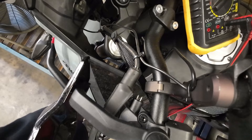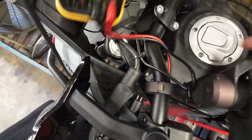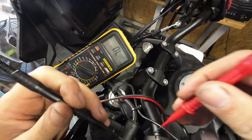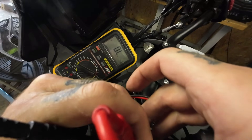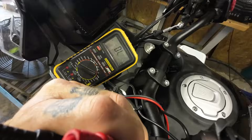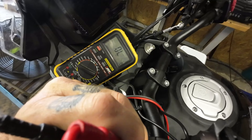Okay, so I've given it some power runs. I've disconnected the clutch switch — I hope the screen's in shot. There's a multimeter there. The clutch switch is down here, two connectors. So I'm on the two pins. With the clutch out — as in as if you're riding — you're all good. Pull the clutch in and we have continuity. So I'll bridge the wires — these two wires here. I've bridged them, so I'll give it a run now and see if there's any difference in power.